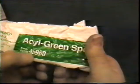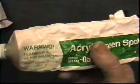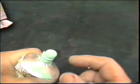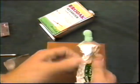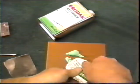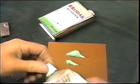The putty — people laugh at me, I say putty like it's a putty cat. The number is 3M spot repair 05960. A lot of times this will get hard on you — see, I loaned this out to somebody, got it back, the cap isn't on tight, and now that first little bit is going to be dry. So what I do is get rid of about an inch of this and then mix a little bit of thinner in there. When this material dries out, this first little blob is usually dry. Of course there's a way around this — you just buy a new tube every year. I think I've had this since I was 10 years old. Anyway, one tube will last a lifetime.